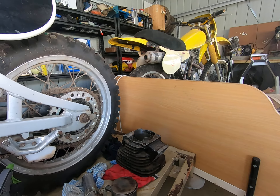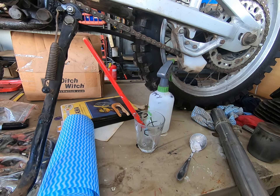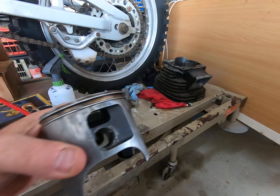In order to do that I'm going to use caustic soda. Get yourself some of that — it's pretty potent stuff so be careful with it. Mix about a teaspoon in about 100 mils of water, stir it up in a dish that's going to be thrown out later, because it is very toxic stuff. We know that caustic soda creates a chemical reaction that dissolves aluminium, and we can use that to our advantage.